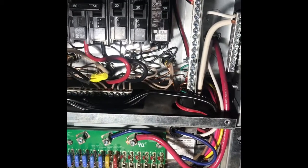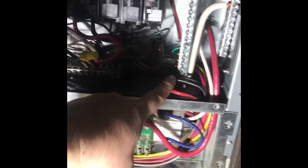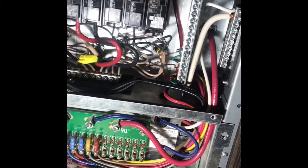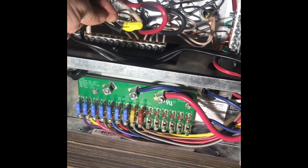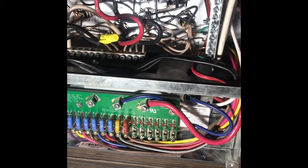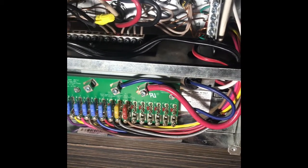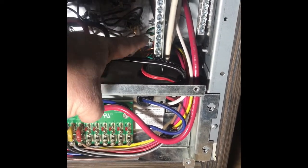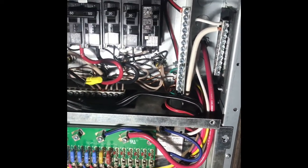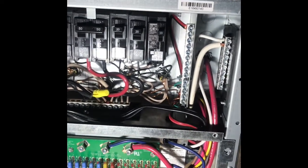Okay, we've completed our AC wiring. We'll go ahead and follow where that is. Remember, we had 3 strands coming out here, 2 black. The first black I wired into the pigtail here. The second black I wired to the common line here, and it doesn't matter which one is which. They're not in polarity. And then the green wire I wired to the common AC rail. So it looks like we're wired up correctly. I'm going to go ahead and put the chassis mount screws back on, and we'll connect her up and then test her out.